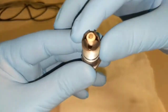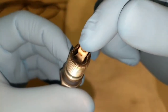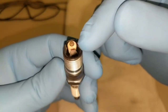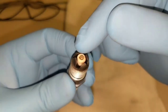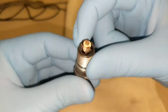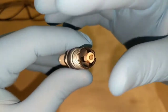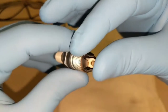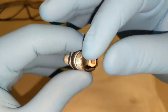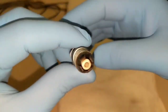As you can see here, just like they advertise, you can see these little brown spots on the porcelain — there's one there, there's one there, some are a little darker than others. That shows that the spark is indeed going to all of the ground points. It doesn't matter what's going on — the spark always finds the path of least resistance, and it now has four options to ground to: four ground straps.